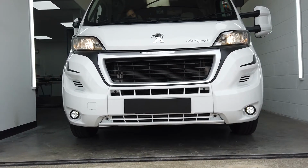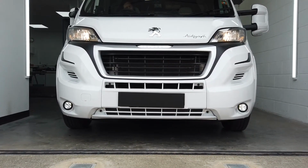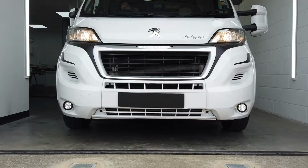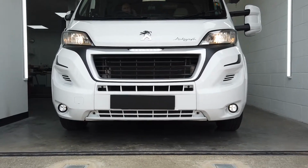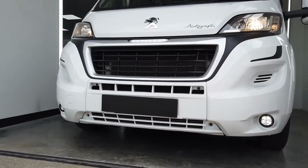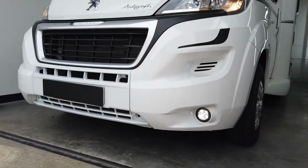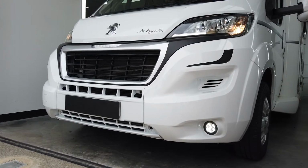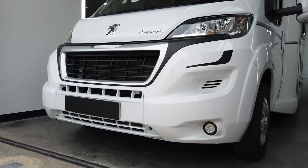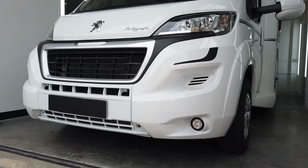You've now got your side lights on the vehicle, and if Richard also puts dipped beam on, I think they probably already are. Yeah, I think there is only 2 switches on these, and even if he does main beam, again nothing really changes. The LEDs are just on 50%. As soon as he turns the lights off, they go to maximum brightness. So they are on continuously and permanently when the ignition is on, and when the key comes out, they're all off. So this is a nice way to integrate in with the vehicle's headlights already.